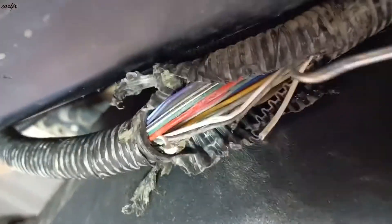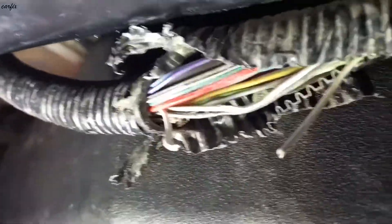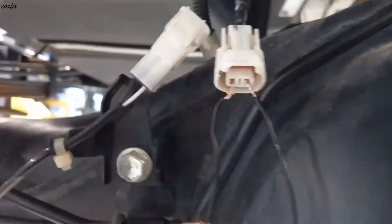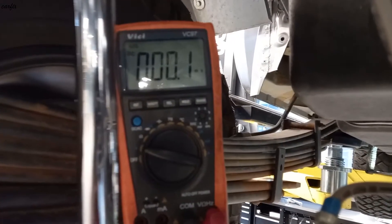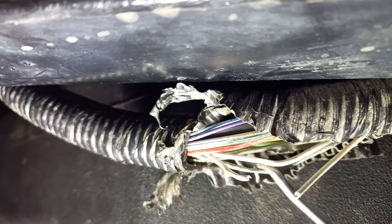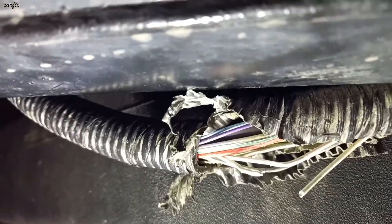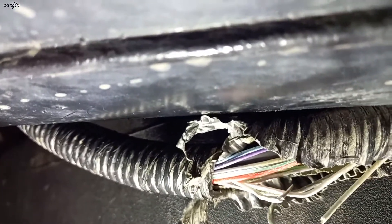You can see the three wires are damaged. The white wire inside is broken. The voltage is now reading zero. This black wire is somehow shorting to the white wire — that's why it's showing high voltage for that left-hand sensor.